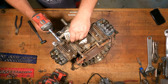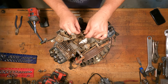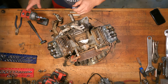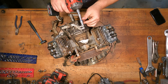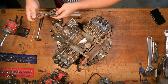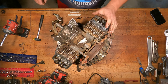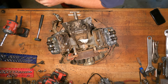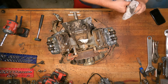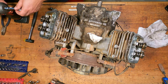There'll be four of those. The governor assembly needs to come off. For reference, the exhaust bolts have a hex or star head and the governor ones don't — they're a little bit longer in length. I'm actually going to leave the governor arm up here because I do not want to lose those springs. I'm going to stop the camera and pull you guys a little closer as we proceed to take off the heads. Another 12 millimeter bolt.